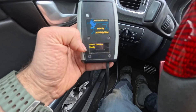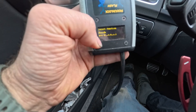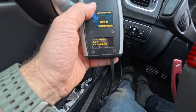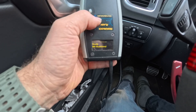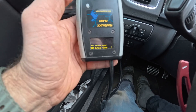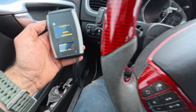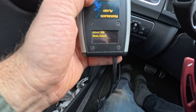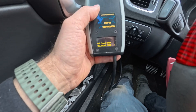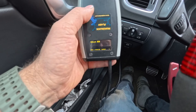Navigation is pretty easy. A short press — a quick press — switches between selections; you can see the underline moving. To select something, you long press. So to go to flash, short press to get there, then long press. You'll see Denso Petrol — that's our P3. The next options are ME7 2005-plus and pre-2005, which I'm guessing are for older S60s and older Volvos. I'll go back to Denso — that's mine.